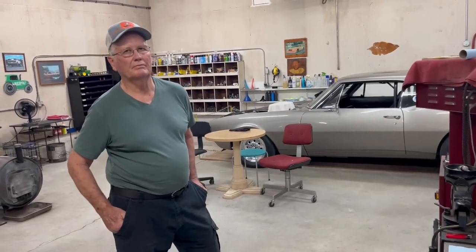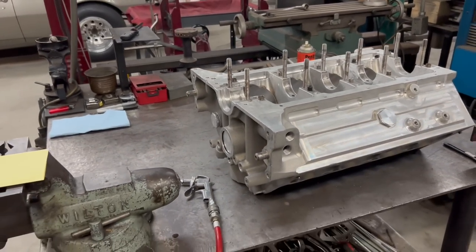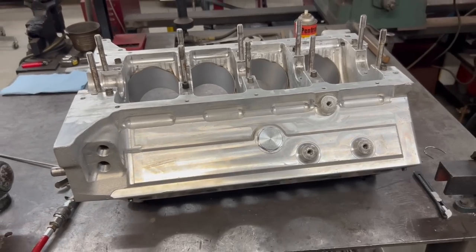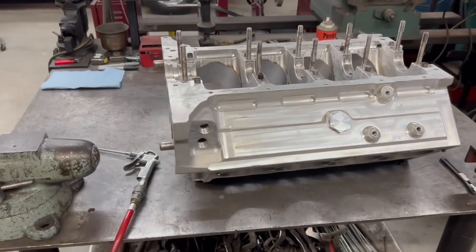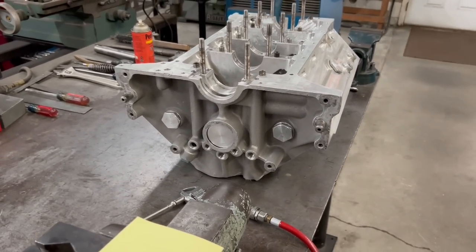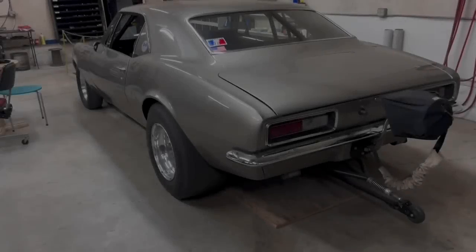We got our motor ready to assemble. I got all my parts and pieces coming, so hopefully in the next couple of days I'll have the bottom end together. He measured the deck height for me — it's 9.055. My old one was 9.02, so I ordered a slightly thinner head gasket. We should be fine there and compression ratio will be about the same. The aluminum motor is going back together. Appreciate you Bobby — BND Automotive, y'all go check them out.